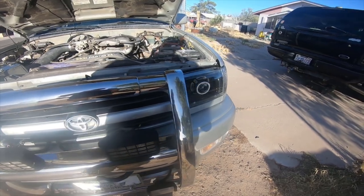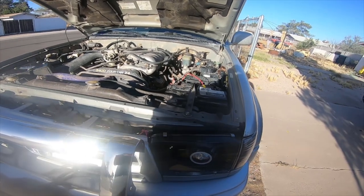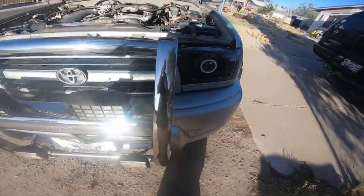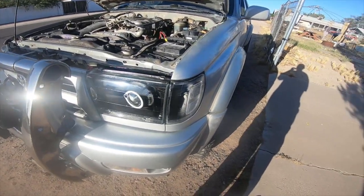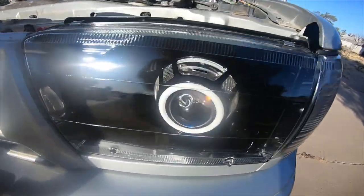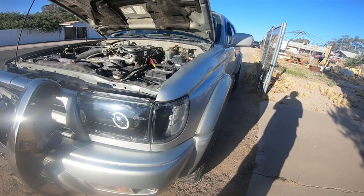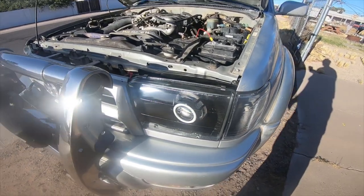The wiring took a long time to get everything routed, placed well, and secured. I had to rewire the lights on my ram guard and do some other wiring. I ended up wiring the front 80mm halo — that white halo on both sides — to the blinkers, so they're wired to the trigger side of the blinker. When the blinkers flash, those turn amber and start flashing.